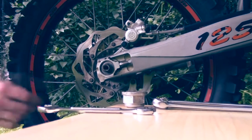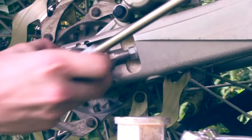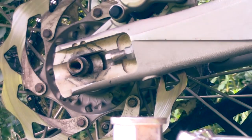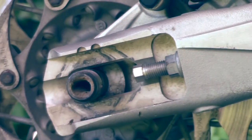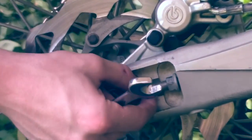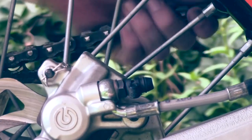Your next step will be to take your screwdriver and pry this part out. It's a bit hard to get out because of all the dirt. If you're having trouble taking off your spacer, just loosen your adjuster and it'll come loose. Your next step will be to loosen your locking bolts and screw your adjusters all the way in so that you can get your chain off your rear wheel.